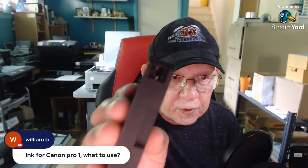I used to get a ton of these, aspirate the leftover ink because people tend to pull them out prematurely. I don't know why. And I'm able to then feed my Pro 1s. I refilled my original cartridges. I use single-use chips to be able to continue printing. And I was selling sets of these that I pre-modified. If you look at the chip compartment, I don't know whether that's focused or not.